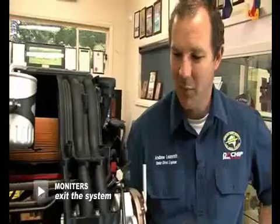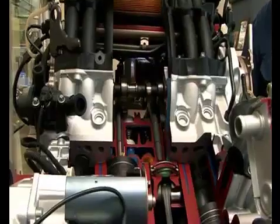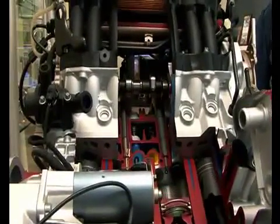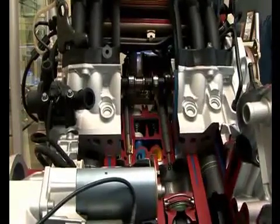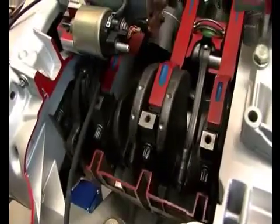What is a common rail? Very frequently asked question. Common rail, or it's a common tube basically — starting at this end and running through there. You can see the green in the cutaway is basically a tube. It has the injector lines connected to it, coming off and going to each injector cylinder. There is one supply line of fuel that's brought to that rail.